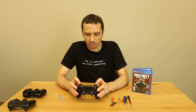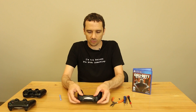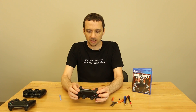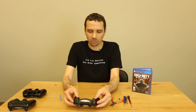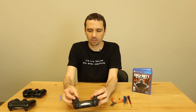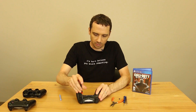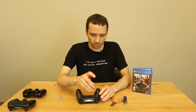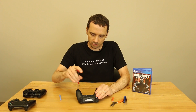Don't push it all the way closed yet because we've got to make sure this is all lined up. On this controller this is a super easy one — it did kind of line up on its own. But if it's not, you may have to push it back and forth a little bit to get it lined up. Once that's done, we're going to push down on it and you can hear it clip — these two clips are clipped in now. Then it's still kind of loose on the back, so we're going to push it right about here or here and you should hear the other two clips clip in. Then we're going to take these four screws and put them back in. After you get these four screws in, you're going to call it done.